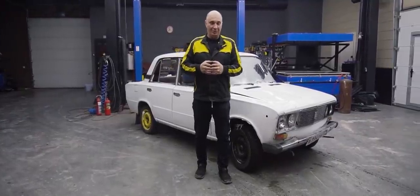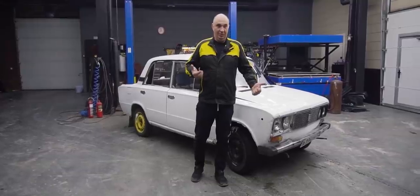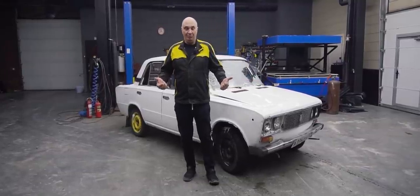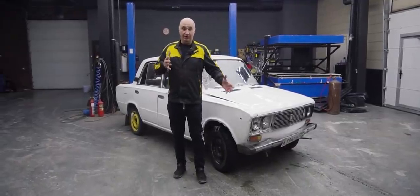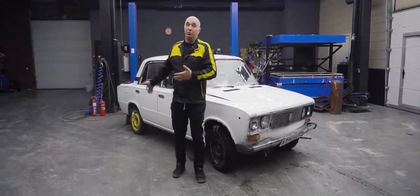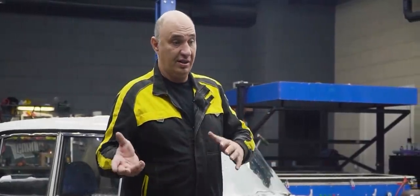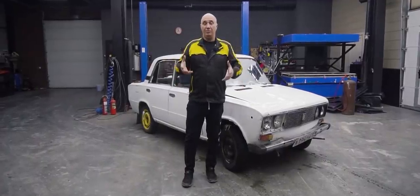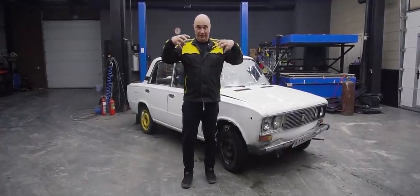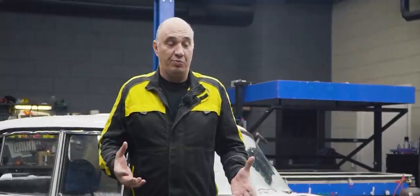And so I expect this to be a pretty interesting experiment. We'll have a look at how they fit, what they do to the appearance of the car, and then some of you might even be able to guess what's keeping us from achieving dramatic angles when doing things the right way and hacking the suspension. The problem with that when you're working with the driven axle, and it doesn't matter whether it's the front or the rear, is that you've got axle shafts, CV joints and such. They're the main limiting factor because they're restricted in their movements. It simply isn't going to work.